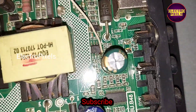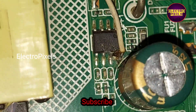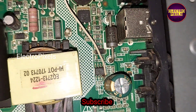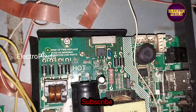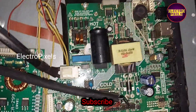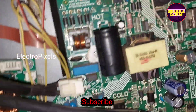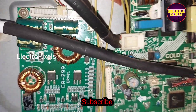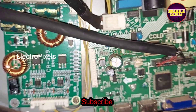We installed a double coil backlight inverter board in this TV. The backlights are working properly, so the fault is with the inverter section of the motherboard. The model number of the universal LED backlight driver board is CA299.